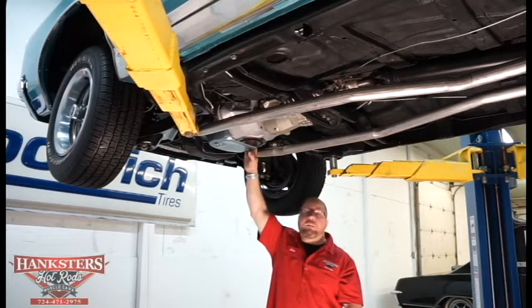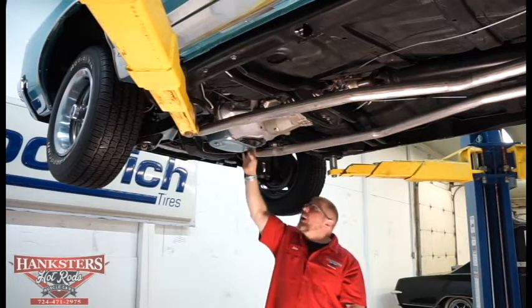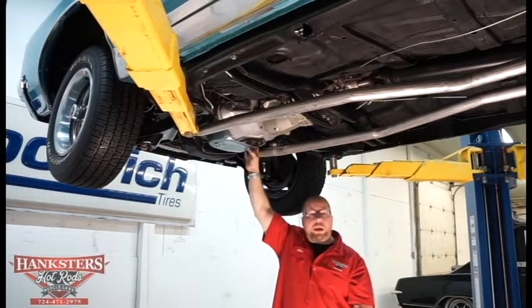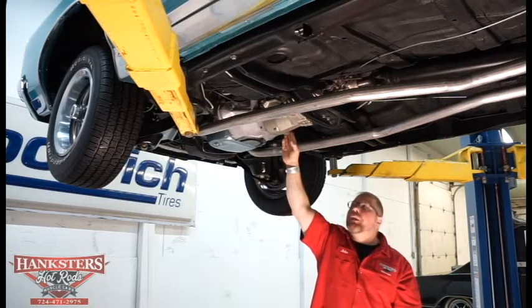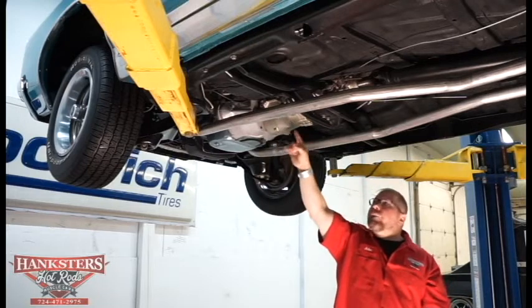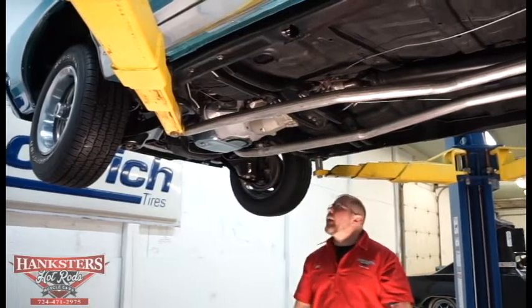Now, right above that, our motor. We'll just talk about our driveline real quick here. The driveline consists of, this is a non-original motor. This is a 400 Pontiac motor. So again, after running all the numbers, we can tell it's a YY coded block. Now, coupled up to that, we've got a Muncie M21 4-speed transmission. We can tell that because the Muncie M21s have the stud with the nut that the shift levers attach with. So that is what we have in here.